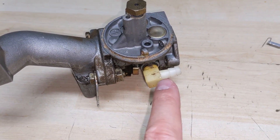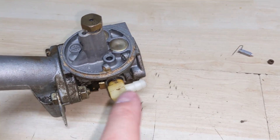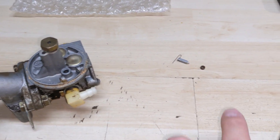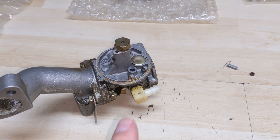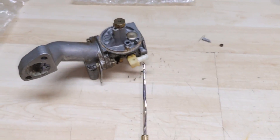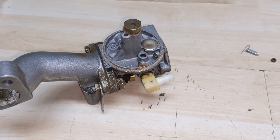There's our fuel inlet here. Fuel comes in to fill the bowl, and when this is upside down the float closes and pushes the metal needle in towards the seat — that's what stops the fuel from flowing from your tank into your carb. As these little tiny seats get old they tend to crack, which causes a bad seal on your needle and you end up with a leaky carburetor. So the first thing we're going to do is take this tool, hook the rubber seat in this old carb, and simply pull it out to remove it.